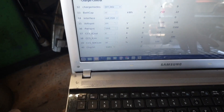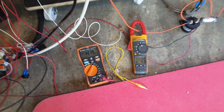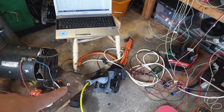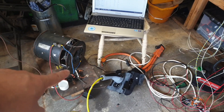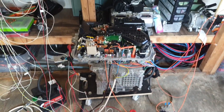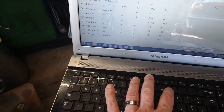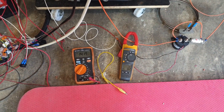If we change this to 1500 watts and press Enter, we go up to 4 amps of current. What will happen is that once I hit a power set point greater than what the control pilot will allow from the EVSE, it will refuse to crank up any higher than what the EVSE allows. So I can come back to the web interface, select zero power, and we'll hear the charger switch off.